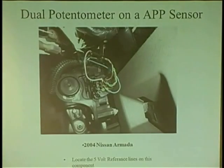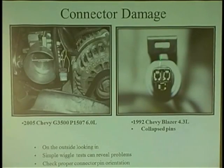It really isn't. So we have potentiometers and we have thermistors. And connections. You're going to see connectors have a lot of problems. They can break right here. The wires can be weak right at the connector. Very, very common, and guys overlook it. Want to know why? Because they're taped up so well, they're all held together. Meanwhile, take the tape off and do a little wiggle and pull, wiggle and pull. They'll go boop, boop. Guess what? That's what your problem is.